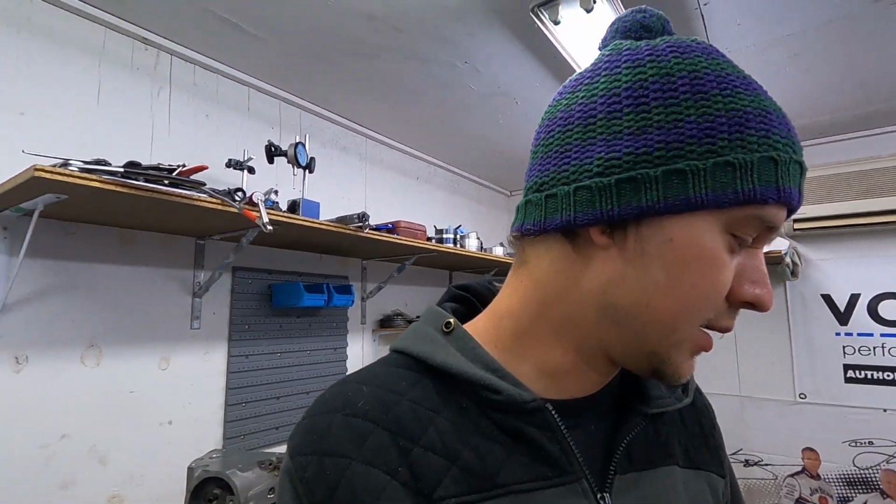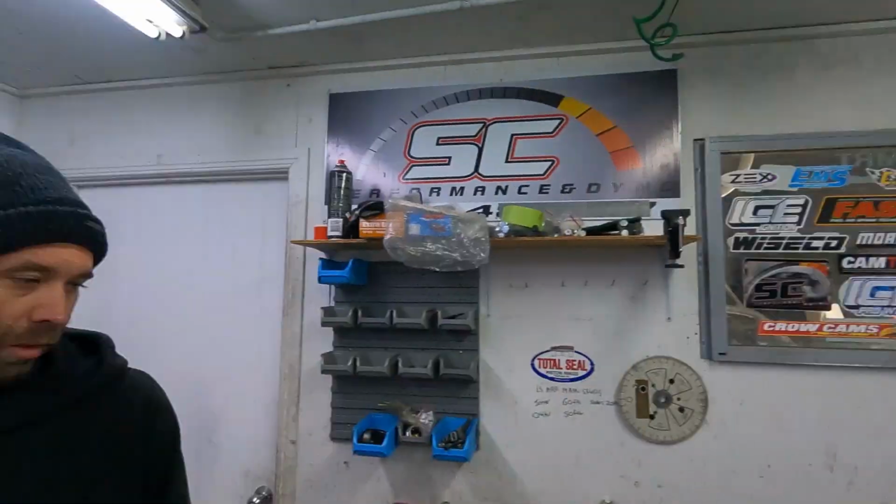Number 5 also had a cracked ring land in the piston, so we suspect that the valve spring that was already broken that the machinist found was probably on number 5, and it may have had something to do with the cracked ring land on number 5. Yeah, well, now I'm wondering if the other broken spring might have been on number 1.